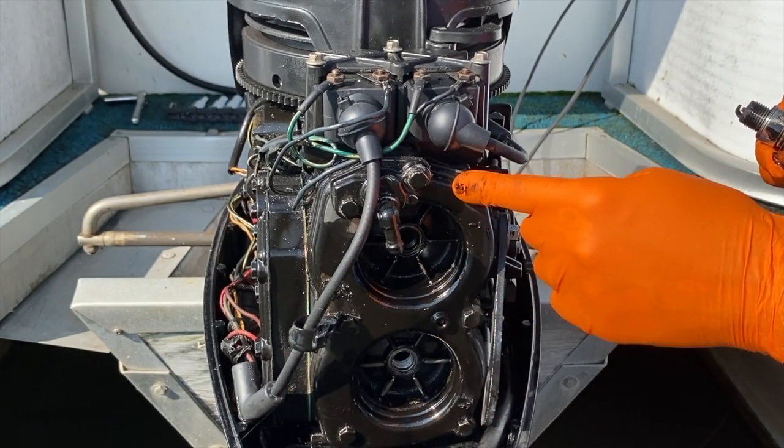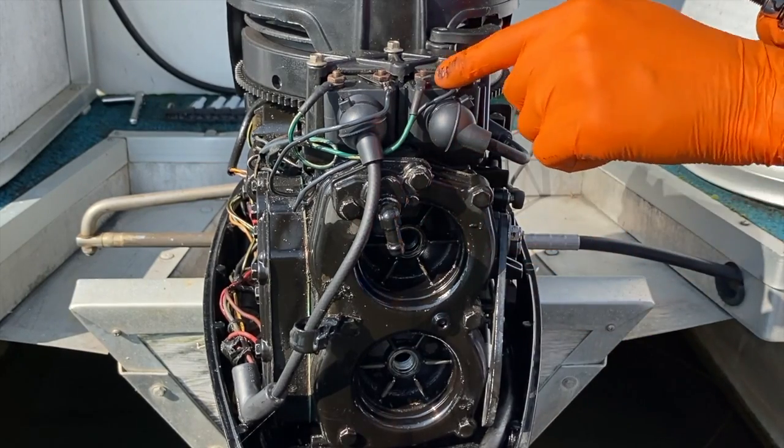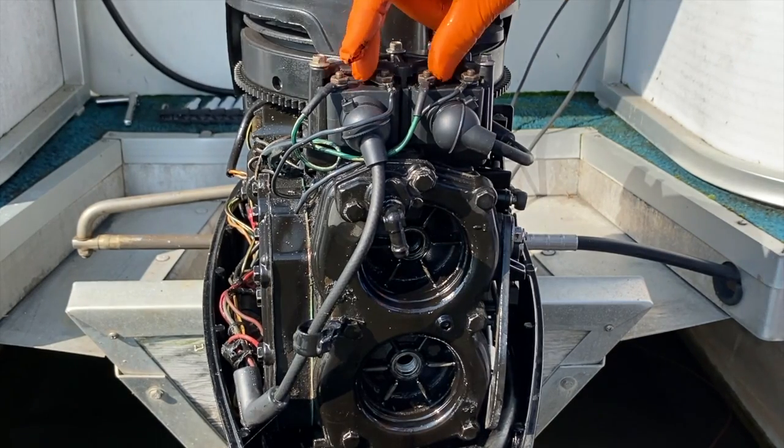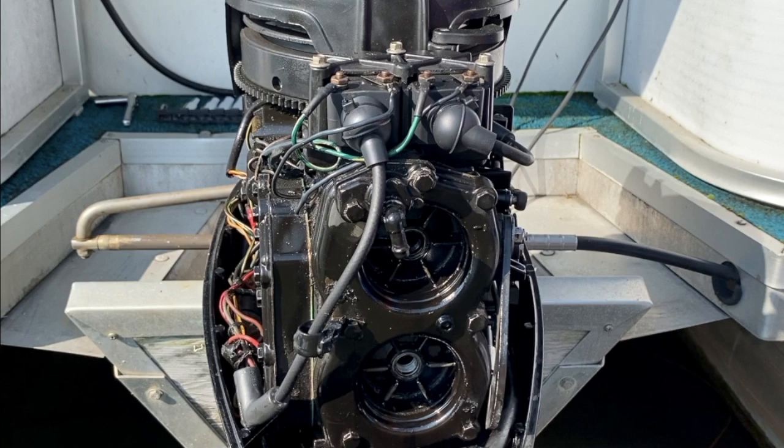That tells us the next possible cause routes all the way up to this ignition coil. In the event that you replace one ignition coil, do yourself a favor and replace them both at the same time. We're going to remove the spark plug boots from the upper ignition coils, as well as all four electrical wires — both positive and both negative — from the terminals on top of the coils. We won't bore you with the coil replacement process in this video; a link to a detailed step-by-step video on safely replacing your ignition coils will be in the description.